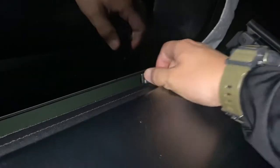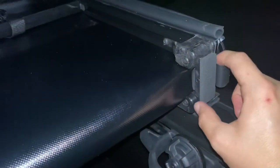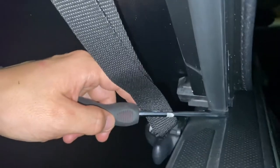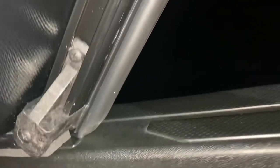I'm going to unclip these and start folding it down. From what I've read about these weather strippings, if you don't keep an eye out when you're folding it down they could crease, so just keep your eye out that it folds down properly without bending back up. As I do the first level I'm going to check to make sure everything is even. This weather stripping is going to want to fold into itself, so I'm going to help guide it. Let's check the other side — the other side's acting up. Let's leave it slanted, check again — all right, we're looking good.